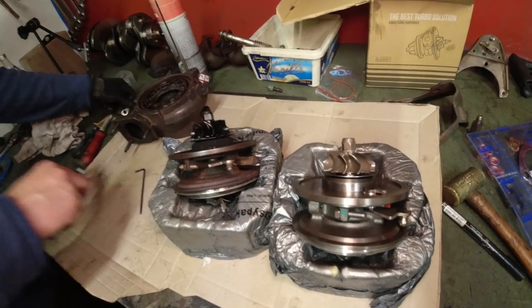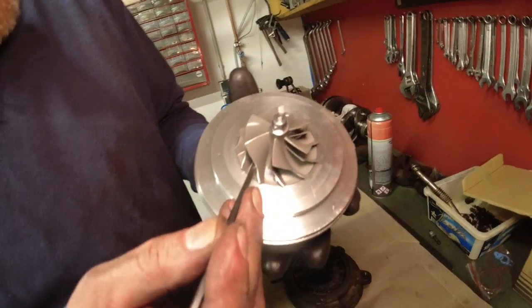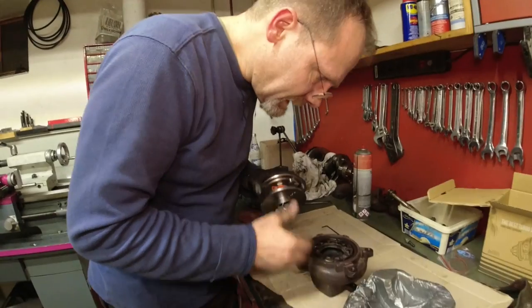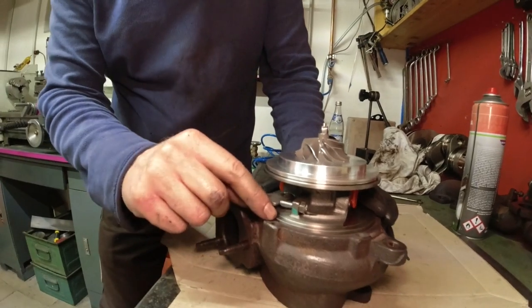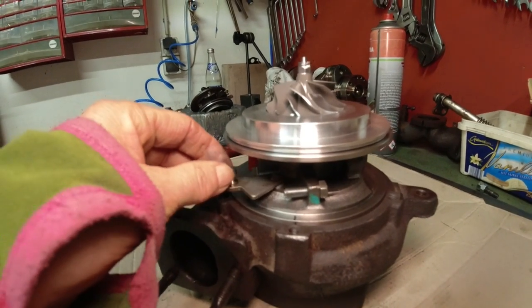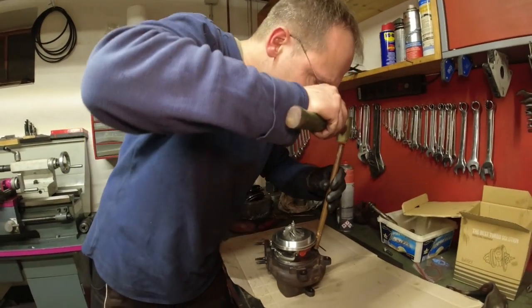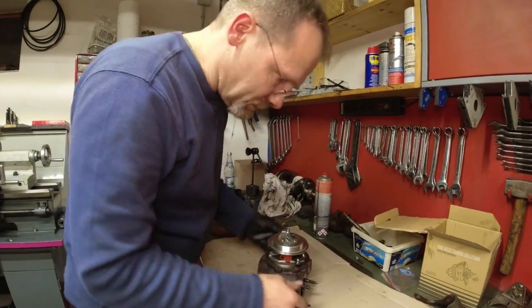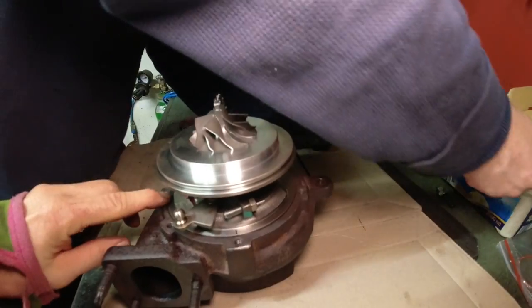The stress level just doesn't go down on that engine — we are already three hours into this job. These are the balancing marks, right here — this one is balanced right here. Got to line up this little dowel, which is really difficult. I marked here where the dowel pin is, and I can feel how this moves the flaps. It's going in really easy now. It's a piece of copper. So it's in — now we can put the bolts back in. This looks good.